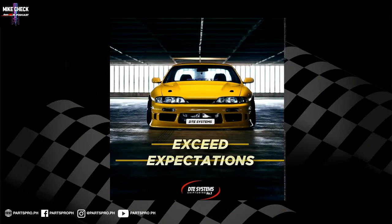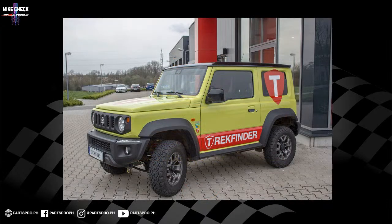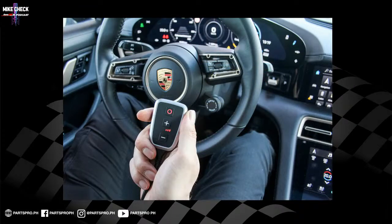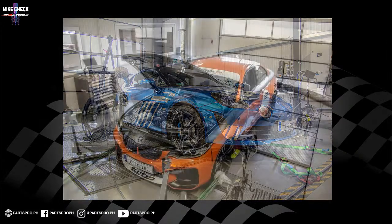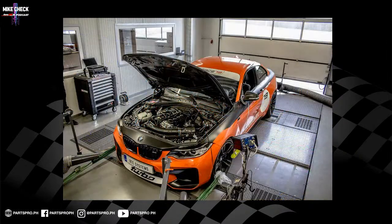So it's different already. And also about the fuel economy, it is closed loop now. So part throttle, they always target the stock. It's not that easy to make them more economical. Unlike before with the Hondas, we just put an AFR of 17 at idle, and a B20 or a B18 at idle, and you would save a lot of gas. My H22 used to get 9 to 10 kilometers per liter.